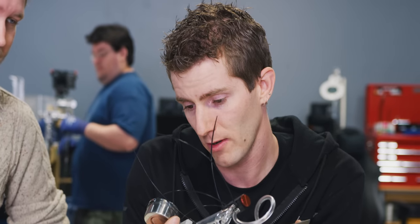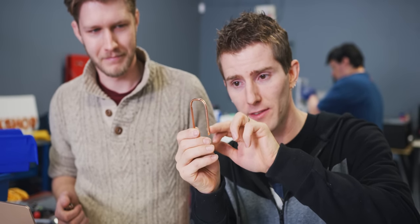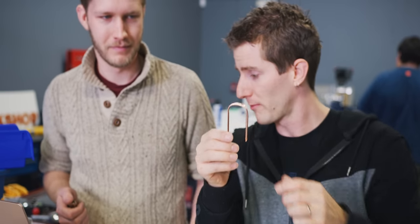I don't hear anything. Needle's not moving. I also want to make sure that this heat pipe right here didn't collapse. The thing about a heat pipe is you need to have the fluid inside able to move freely. So if you accidentally kink it and impede that movement, that can be a big problem for performance.